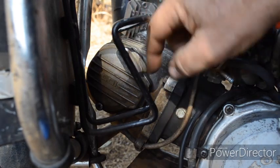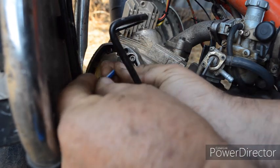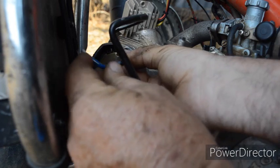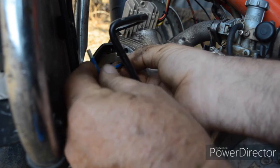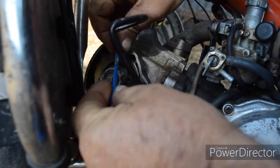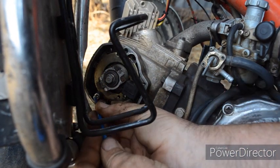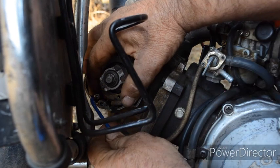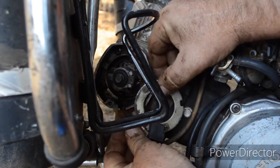I'll take these two screws out and remove the CDI cover. Now I'll take out these two cap heads — yours will be JIS screws, I've changed mine — and I can remove the pulse generator and the pulse generator plate. I said CDI cover but it's not really; the CDI is just a pulse generator. On the 12 volt bike there's no pulse generator in the cylinder head — it's down on the end of the crankshaft. The screws are removed and I can simply pull out the pulse generator plate.